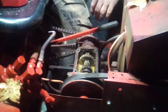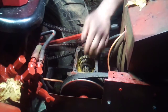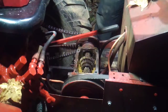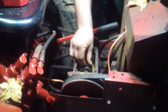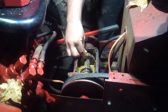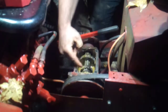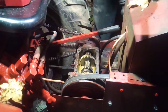Before you put it on, this part is important — you've got to find out where these gears lie. When this messes up, sometimes it will bind and you won't be able to get it to turn or do anything; other times you can only get it into one gear or neutral. You want to slide them around in here until you can find out which position is neutral — see, that one still moves the chain so it's not right, but this one is not moving any of the drivetrain. Keep it right there.